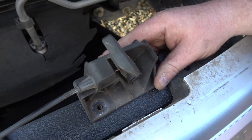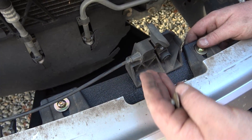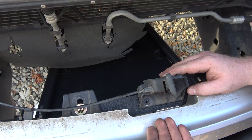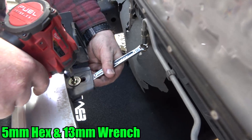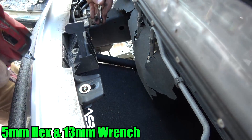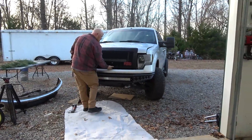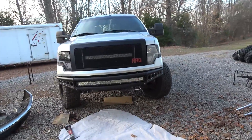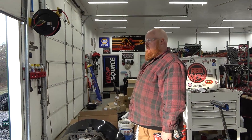Our hole is just a little bit off, so I'm going to file that out and make the hole wider so we can bolt that in, then tighten up these two bolts. For reaching in, I'd imagine all the way forward is most comfortable — your hand needs to reach in between the grill and hit the latch. Using a Dremel I opened up that hole, tested it, and all the way forward is best. Make sure the latch is good and in the comfortable position. The only thing left to do is zip tie the fog light harness up onto the chassis so it's not in the way, and then tie in the power so we'll have the light bar on with our fog lights.